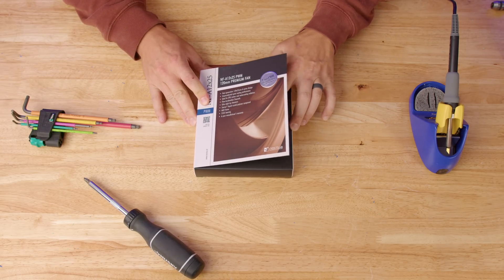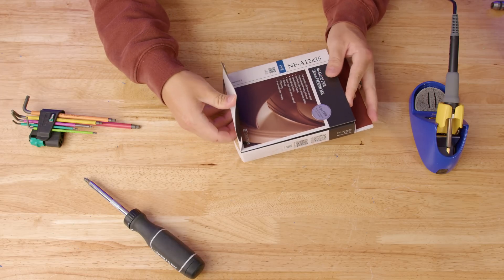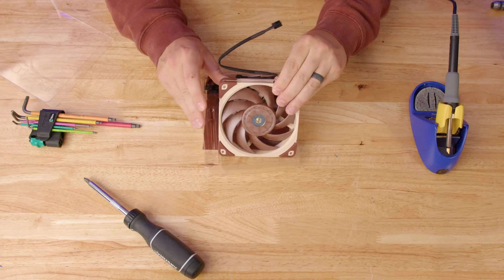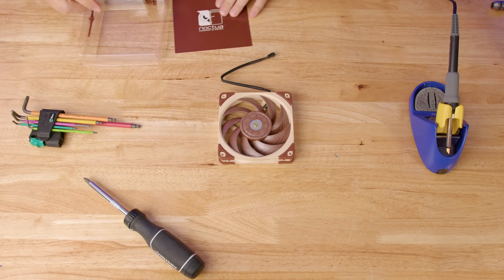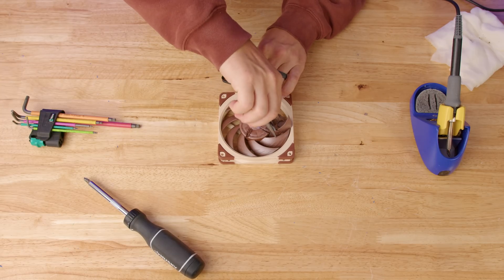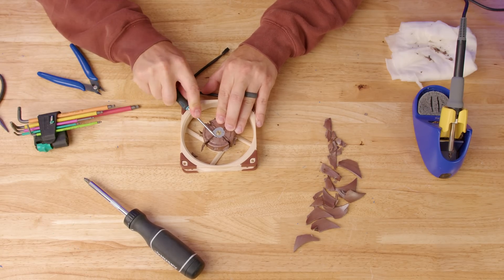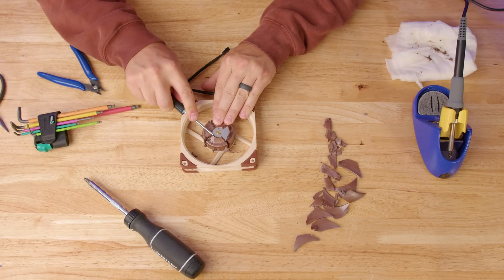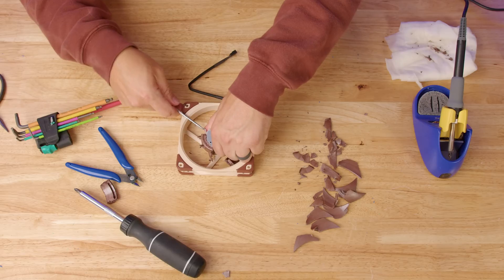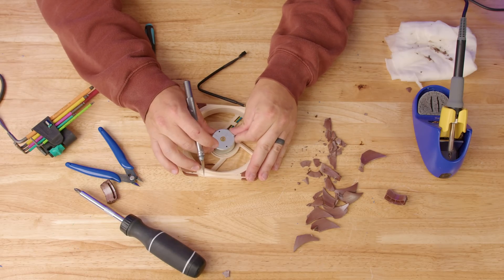The first step is taking one of these fans and destroying it. If you want to buy your own A12 X25 and test your fan design at home, I'll show you what I think is the easiest process for taking this fan hub off. I've used many different ways over the last year — from Dremels to clippers to side cuts — but I think the easiest way is to use a soldering iron and a tip you don't mind messing up. I set my soldering iron to the hottest possible setting, and in a well-ventilated area I melt the hub into quarters. You can also break the blades off, which makes things easier to handle. After the blades are removed, I continue melting down the side of the fan all the way through, then using a pick or flush cutters I remove the surface plastic from the top of the fan hub. After everything's divided up, you can use a pick to pop each individual quarter off — they come off pretty easily. The last thing I do is run an edge around the top of the metal hub to remove that last bit of adhesive, which makes it easier to slide your fan on and off.